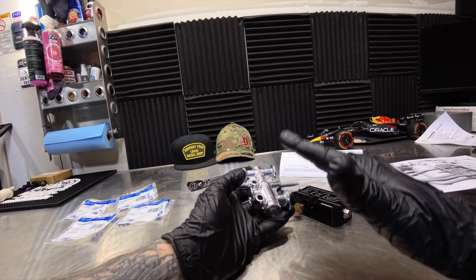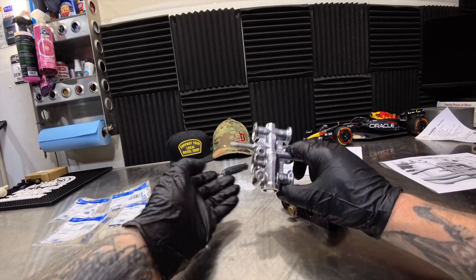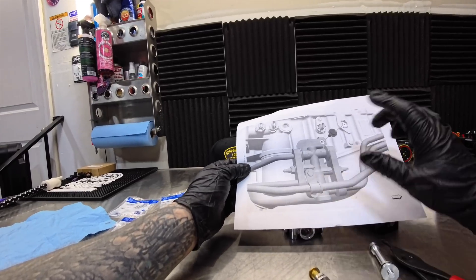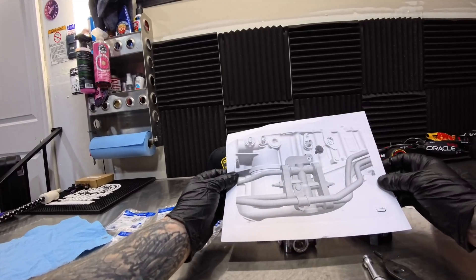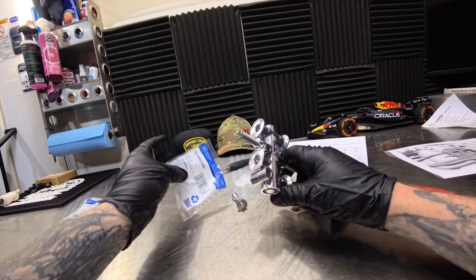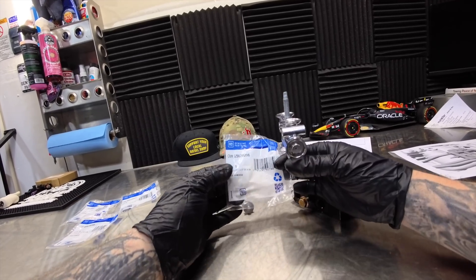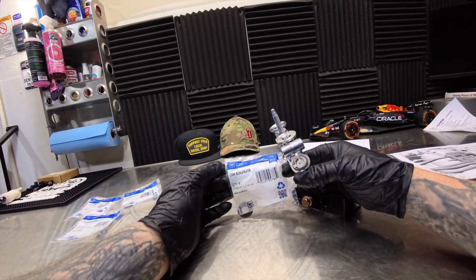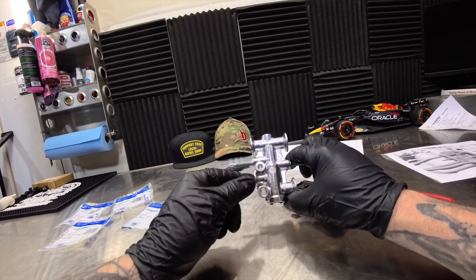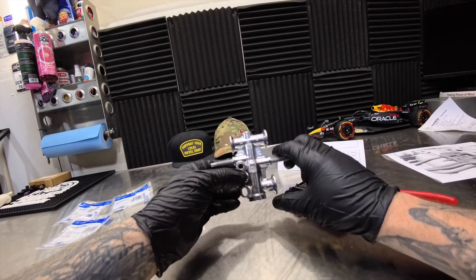This is the factory one. Obviously this is a brand new one that I bought just for this video so I can show how to install this. The valve bolts right up to the side of the engine block down by the oil pan. I also want to point out that there are seals that go to this, and here's the part number: 85-62-8208. I know a lot of people had a hard time finding these — those are the part numbers for those seals, and they were roughly five dollars a piece.